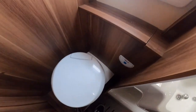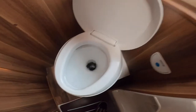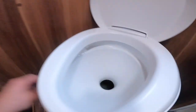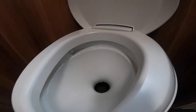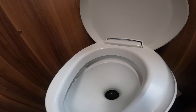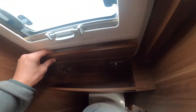To operate the toilet — make sure the pump is on for water — press the button at the back which is your fresh water flush. Flush the toilet first to lubricate the blade and its seal, then slide the blade handle to the right to open the hatch, use the toilet, flush, and then close the blade. If you want to use any bowl cleaner, put it in a spray bottle, spray the bowl for cleanliness and fragrance, then flush after. On the back you'll see a green light meaning the cassette is empty and good to use; it'll slowly go red until solid red, which means it's full and needs to be emptied and topped up with chemical. Handy cabinet there for your toilet rolls.